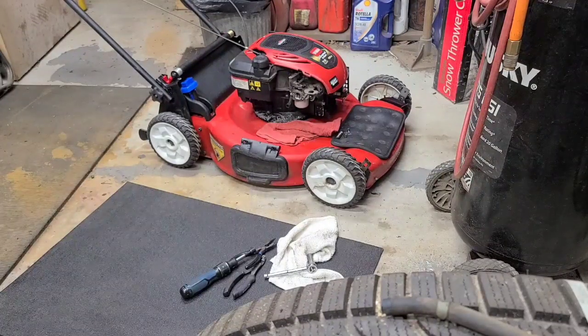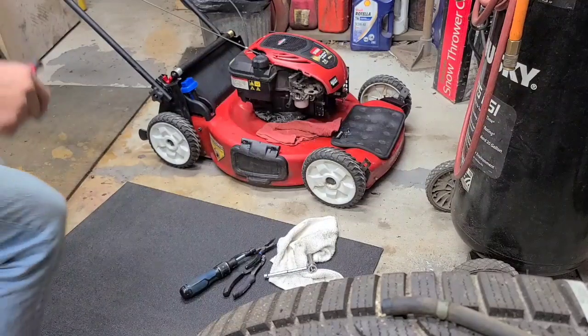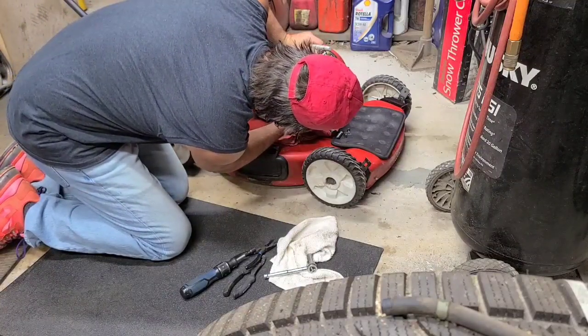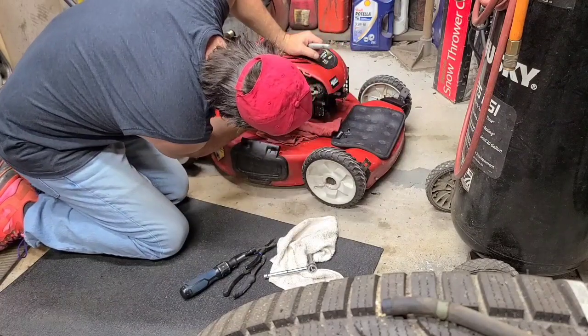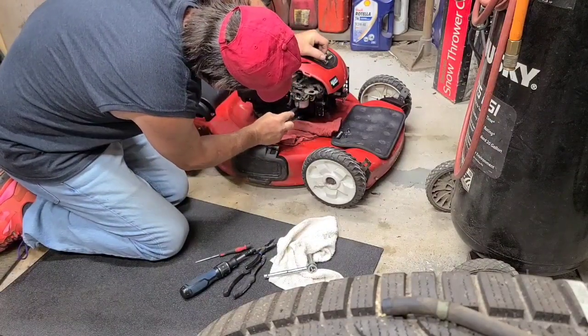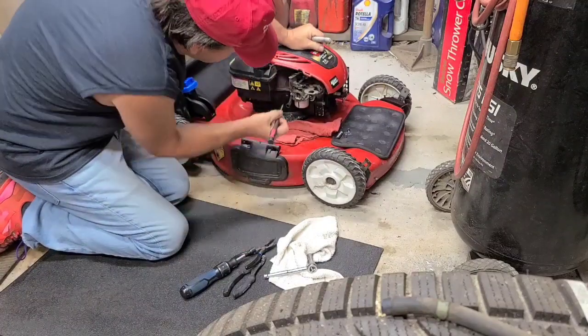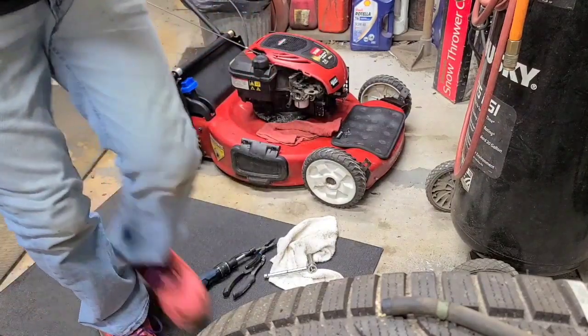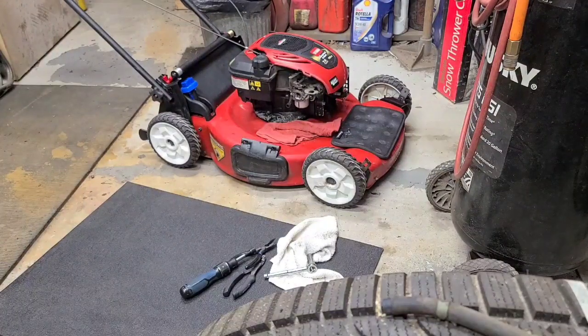I always do this with the marker. Matter of fact, I guess you grab a... Hang on. Grab me a pick too. I was doing this with the marker and then I brake clean it, or wire brush it and take the marker off. We got something, like I said, some of these bowls I've shown in my last video have highs and lows spots in them. You gotta put them back on the right way. If not, the float can't drop.